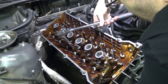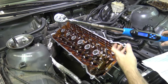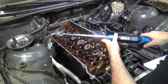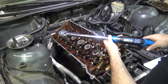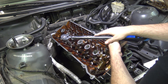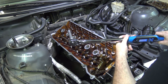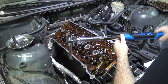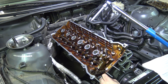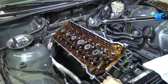The ones most likely to have pulled are the ones in the middle, because that's where a head lifts the most. So I bought this digital torque angle wrench — the Eastwood 13622 — just for this purpose, for engine rebuilding. Snap-on actually makes this tool originally and theirs is like $400, but Eastwood makes a version for $100. It'll do up to 148 foot-pounds. You can do the initial torque in foot-pounds and then it'll measure the angle for you, so I don't have to mess around with any separate angle gauges.